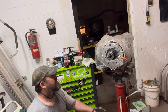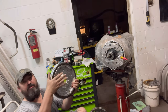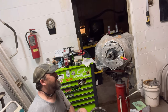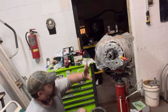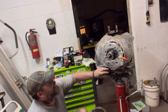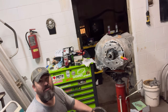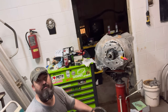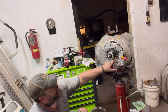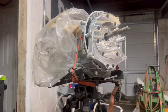And yeah, the next piece is this goes to the motor. Obviously, you know, the back to the motor. Put your clutch kit on, 350Z clutch and pressure plate. Put the bell housing on. Well, you bolt this down, get it tight first, and put the bell housing on, and then you put it in the car. Your supply line for your hydraulic fluid coming from your clutch goes in this line, and that's your bleeder valve.